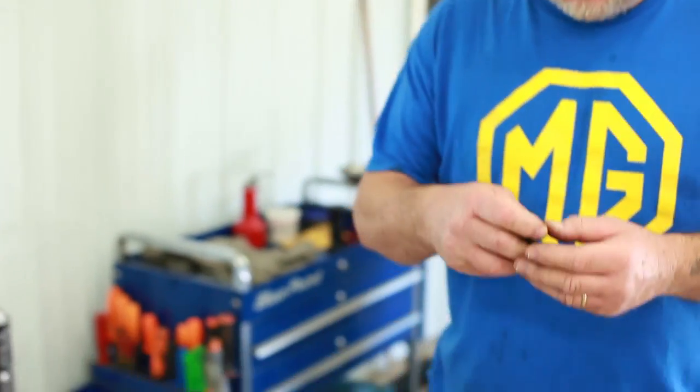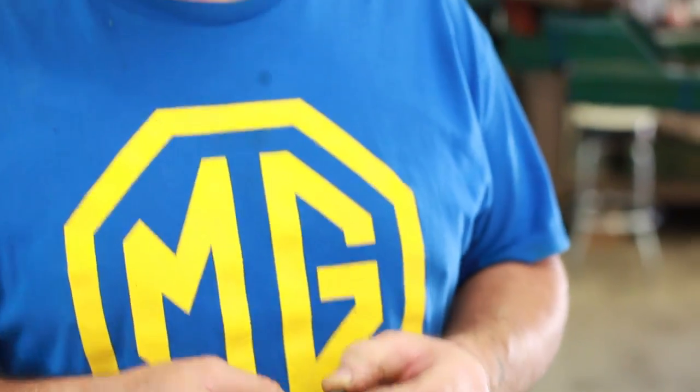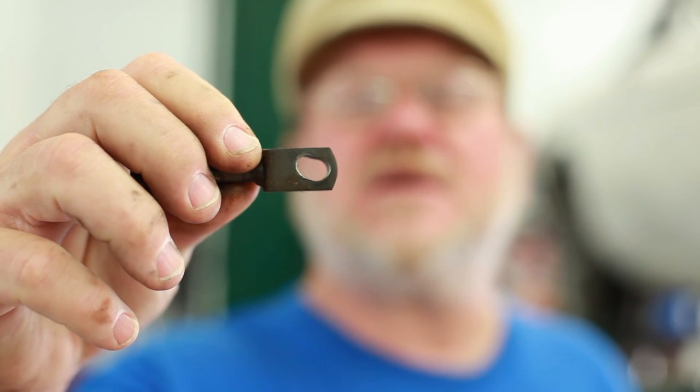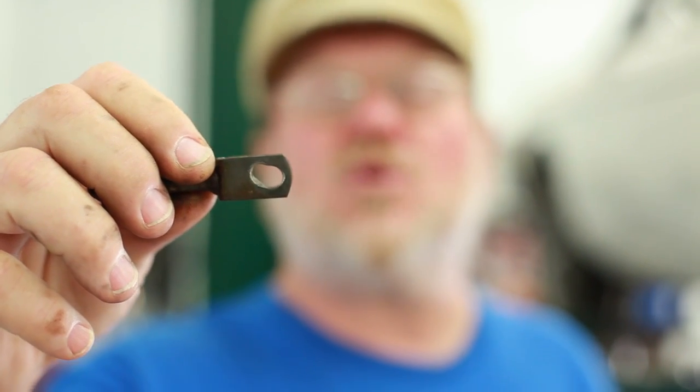Today I want to talk about 2 different things. First, I want to talk about a clutch. We had a car come in with a bad clutch, and you pressed on the pedal and it didn't throw out, the gears ground, and you could feel that the hydraulics weren't very good. But when we went in to do it, we found that the push rod was that worn. Okay, that's pretty worn, more than pretty worn.